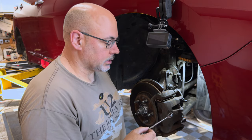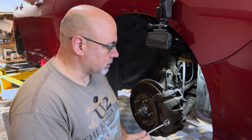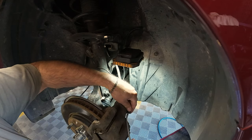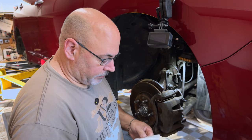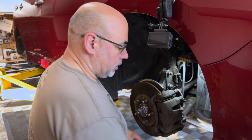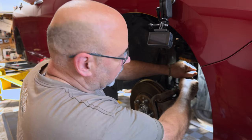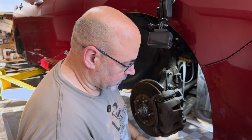If you think the thing's going to be tight, I suggest using a small wrench — this is a 10 mil. There are brake fitting wrenches you can use, but I just like to use these little ratchet guys. It's a 10 millimeter here on this Nissan Leaf. There's a rubber cap you're going to need to remove — I just use one of these little split tip screwdriver type dealios. Pop that off. My suggestion is that you pick up some replacements; these ones have a little retaining collar so they'll actually stay on. I'm going to use this PB blaster — pick your penetrating fluid.